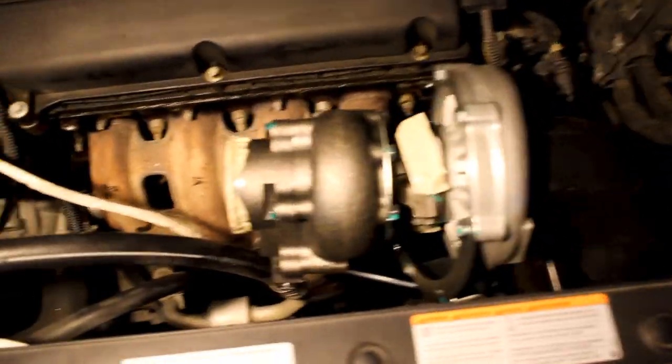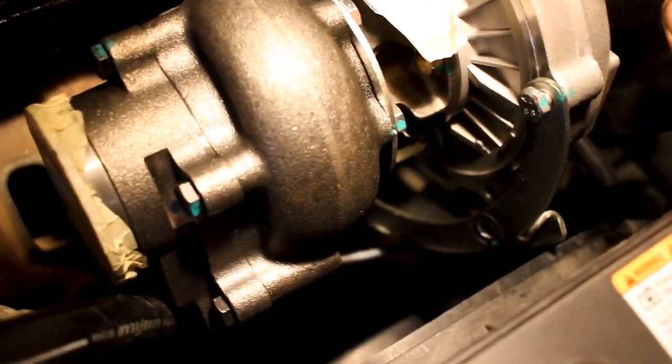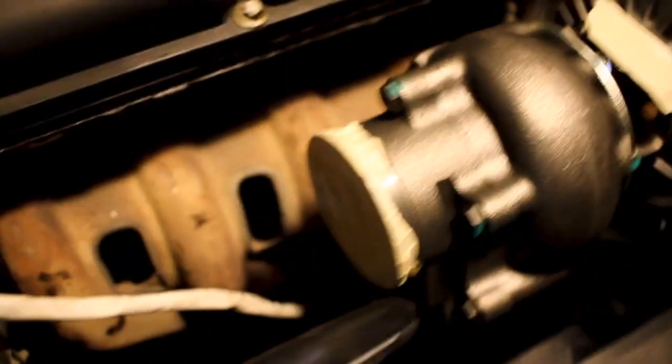It looks like everything's going to fit quite nicely. I'm thinking the air breather can fit here, but I'm also considering routing it down here so it gets some cooler air. Having the air breather here means I'll have to delete the map sensor, which isn't a big deal. This thing will go forward and up just a little bit. I'll definitely have to heat-wrap the AC, but the wastegate is out of the way — I've just got it hanging at the moment. I'll probably have to modify the bracket so the angle is correct, but I'll figure that out once I get it out and figure out my angle.